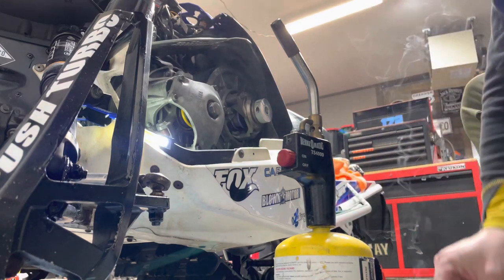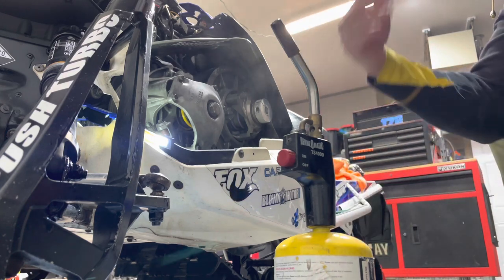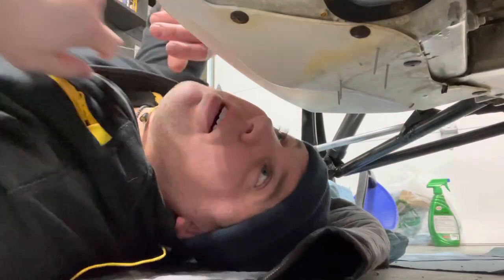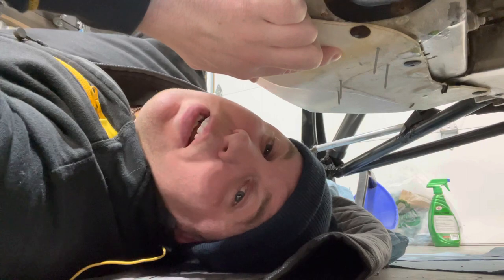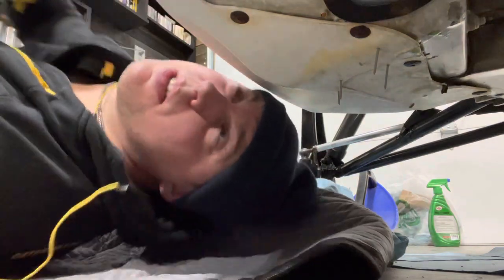And right through, we're in there. Now I can drill up from the bottom and get my holes for my rivet set. There it is. Okay, we got our nails sticking out here holding in the aluminum plate up here. So I'm gonna just drill some of these that I have just tapped out. We get the right angle.